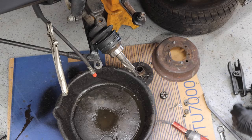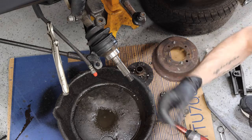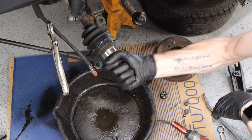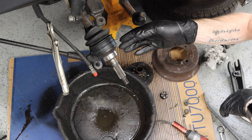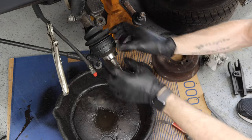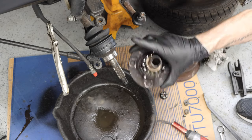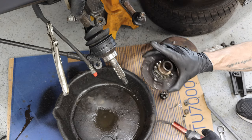While you're doing these kinds of jobs, it's always a great opportunity to get into some of the parts that are harder to clean. This outer CV joint is a great example — it was covered in grease when we took this off, so we're taking this opportunity to use brake cleaner and get all this stuff cleaned up nicely. You can also check on this outer CV boot — they have a tendency to fatigue and tear down the sides. If that's bad it will have flung grease around the area and will also allow dust to get into your CV and damage it, so it's really important to take the opportunity and also replace that.